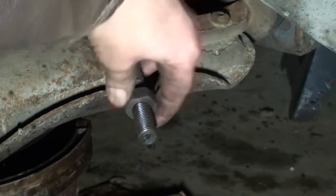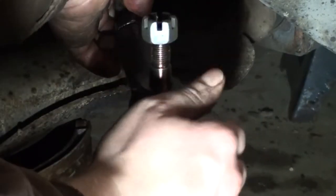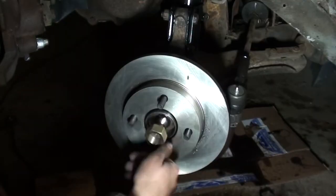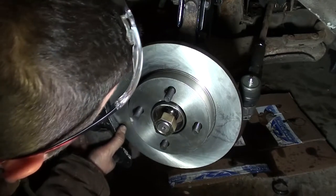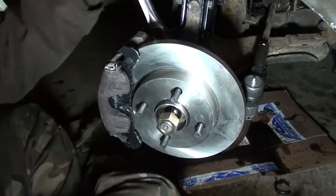With the strut connected, next I put the tie rod end on — ran the jam nut back down a little bit, cleaned up the threads, lubed it up, then put the tie rod end on. I wanted everything to be nice and loose because I was going to bring it in for an alignment right after putting it all together. With the rotor on, we can thread on the axle bolt just enough to keep it from falling out and put the brake caliper on. You can't tighten this nut until the car's on the ground, because if you turn the axle the other one's going to turn in the opposite direction — just the nature of the differential.